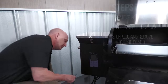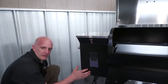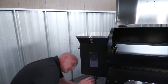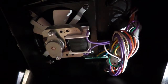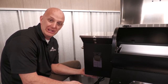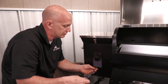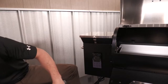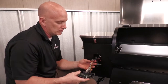First thing, we'll remove the bottom screws. Now that I got the bottom panel removed, I can get underneath here and start cutting some ties. We remove the bottom panel and cut the wire ties that are securing the wires to give us some slack. Next, just remove the two screws holding the control board on. Now we have enough slack to remove everything.